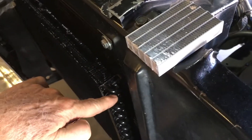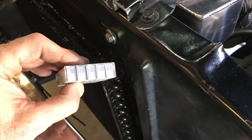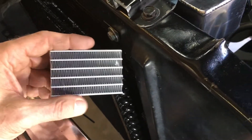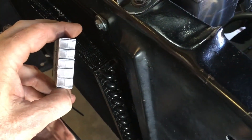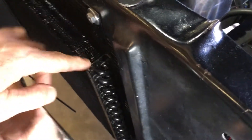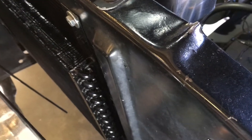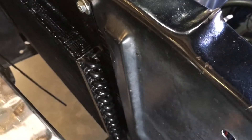These tubes are round tubes. In today's cars, with R134 and now R1234, we have serpentine condensers. This condenser is just a little cutaway for demonstration, but you can see the flat tube is actually made up of lots of little tiny tubes inside, and it serpentines back and forth. The round tube condenser, like this came from the factory, was designed to move a lot of refrigerant. R12 didn't need a lot of condensing action, but today's 134 and 1234 do need condensing action.